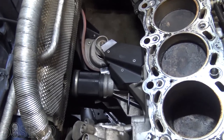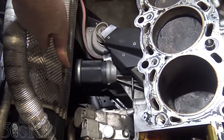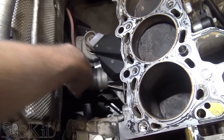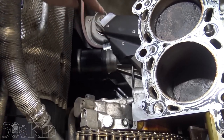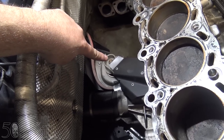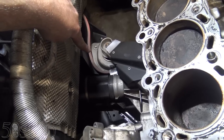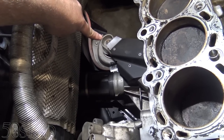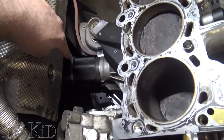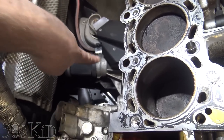So furthermore, you can see down here what I was talking about before. That's the axle that's going into the side. This is the carrier. This is the axle carrier on this side. You can see that the engine mount goes off to the side right there. So we're going to remove that bolt of the engine mount because we'll leave the engine mount connected to the subframe and we'll separate it right there. And we're going to need to pull the axle out of there. So the axle is going to go out that way.